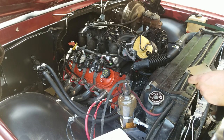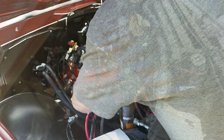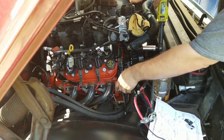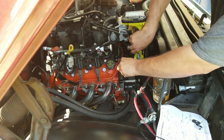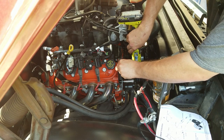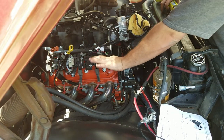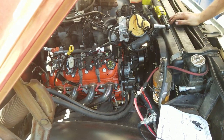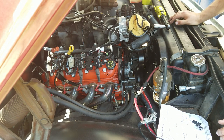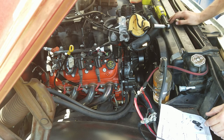Some spacers involved. Not flange bolts, they have larger heads. This is a 17 millimeter head on it, and that's reverse. That kind of tightened. I'm trying to hold this plate into alignment where it needs to go. That looks good. So then this other plate goes on with bolts at the same time. That's the only bolt that goes in the back plate by itself. The other plate has these bolts that go through it and into the head.